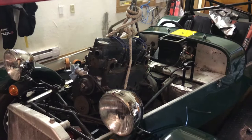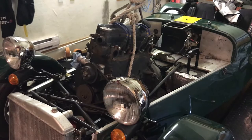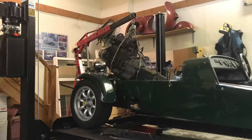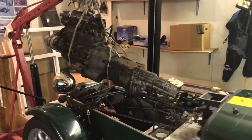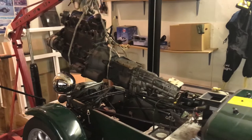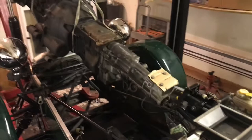So that is the next step here — I'm just going to now give this a little bit of a lift, start wiggling the back of the gearbox out, and we should be all set to go. We are free and clear! We've got the T9 Ford gearbox there, the Ford Kent 1600 engine, crossflow. Everything looks to have gone quite smoothly — I made sure everything was unbolted and disconnected prior to taking the engine out, so nothing really got caught or hung up.